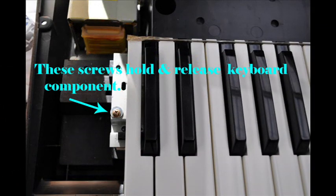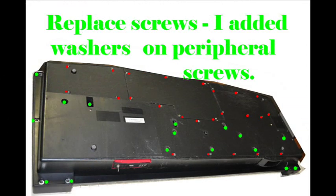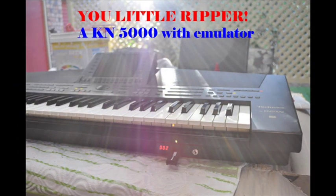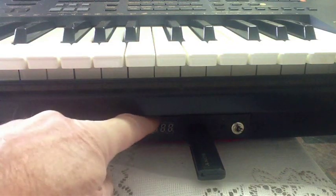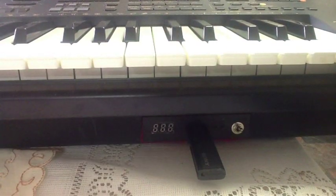Now it's time to put the keyboard back down. Respect the wiring — once it's down, reattach the plugs and put the screws back in. I've used washers with a little bit of wood glue to hold them on the case and strengthen it. Here is the floppy emulator installed in the machine — you can see the felt around the outside. The felt is there because the floppy disk was designed with some suspension to stop jarring, so the fit isn't quite as snug as in the 3000, but the felt does the job nicely and seals around the outside.